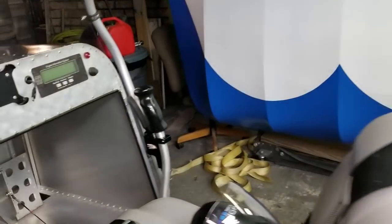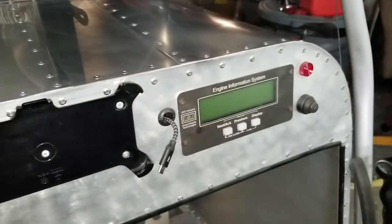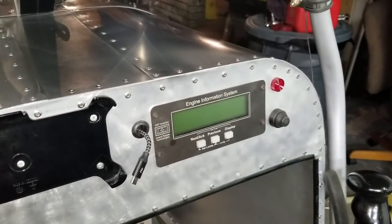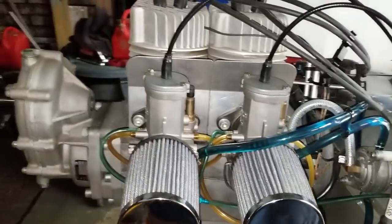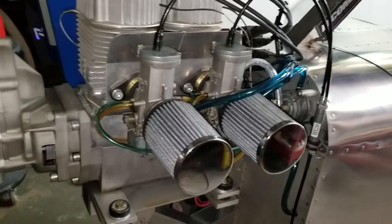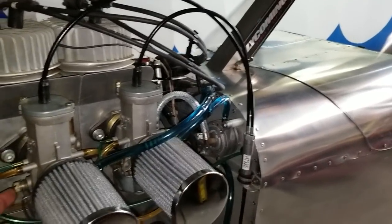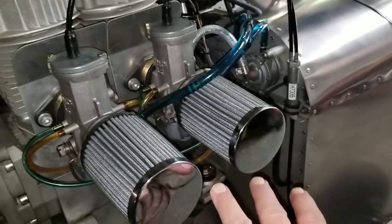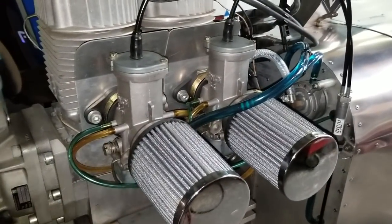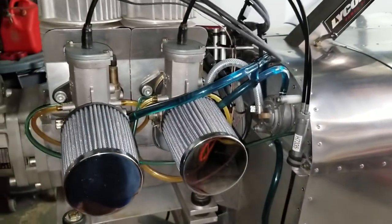I don't want to load this up and take it to the airport until I know the engine is going to behave. We're real close. I'm going to be talking to Matt at RPE on Monday — I talked to him Friday and he gave me a lot of information: adjusting the pitch on the prop, balancing the carbs, setting the low speed and the stops. Everything is looking good as far as the pistons and carbs working up and down simultaneously — everything's staying synchronized.